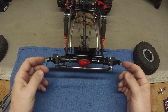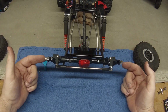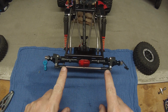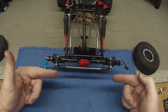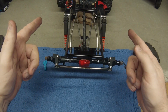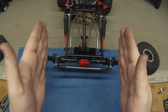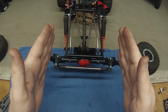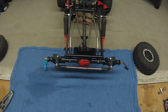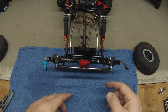I just measured from the rear axle to the front axle, and I measured on both sides and made that distance even. I think it was 12 3/4 or something like that. And I got a bar in there that's about the right length. I can screw these in or out to make it longer or shorter to adjust the toe on the rear. I believe your rear should be toed in just a little bit, just like the front. If not exactly straight, because if it wasn't rear steer, it would be exactly straight. So you want it straight or just a little bit in. I'm going to try to go with straight and see how that does. If I get any dragging, I shouldn't. The front is all set up because it was exactly the same length, so I just switched everything over.